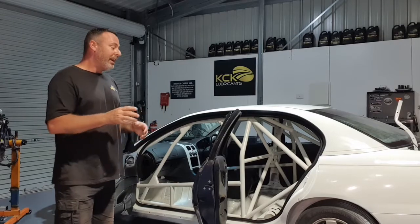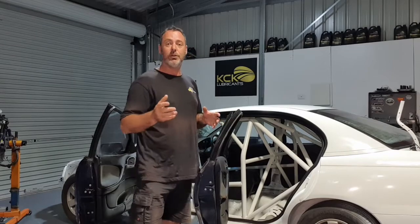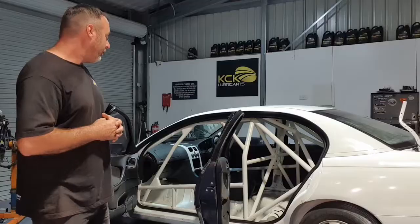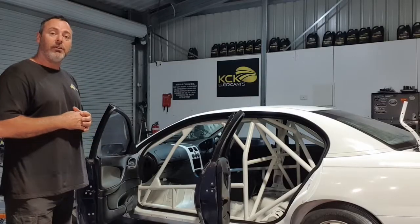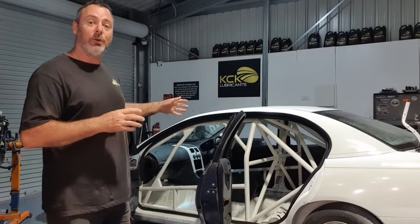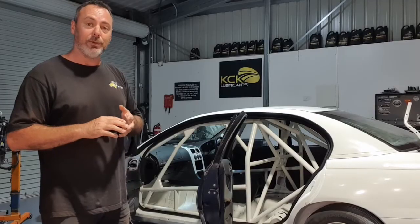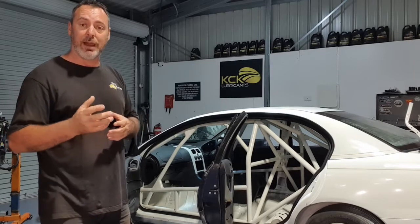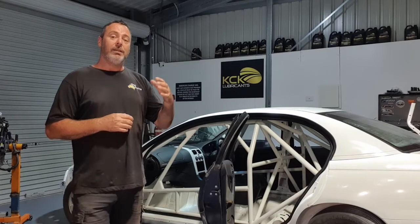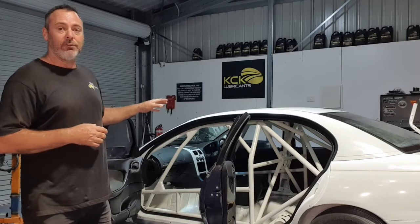Some of the other stuff we've done — instead of making new door trims, we've just modified the original trims. The original trims hit the roll cage pretty hard, so we've just cut reliefs in the door trims so the doors can still open and shut. The dash and centre console's back in — looks really cool, a bit unusual for a race car. We've got the factory heater still in there, the demister's still in there. A lot of the creature comforts that come with the road car we've left in there, just to make it more comfortable. We now have a really good demister should it rain, and all the factory controls are still there.